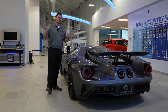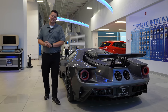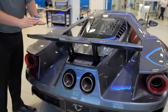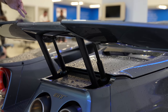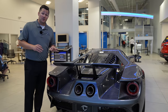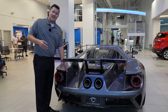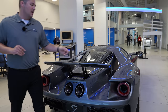I'm not sure whose idea it was to finish the review outside, but now you get to see a review of a Ford GT that's wet. One thing you'll notice is that the rear wing is up. What's so cool about this rear wing is that it's completely hydraulic - it goes up and down and also tilts forward and back to a specific position. Since it's hydraulic it's got a lot of power behind it, and for safety purposes if the wing goes up when you're stopped it will not go back down until you hit approximately 14 to 17 miles per hour. At that speed it'll drop back down, because this is a pinch point - it could actually take your finger off, and there are no sensors to stop it.